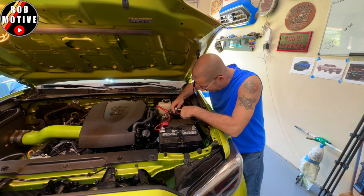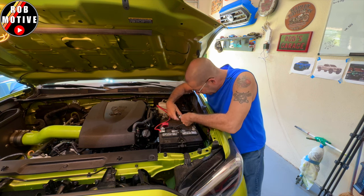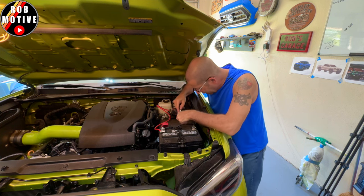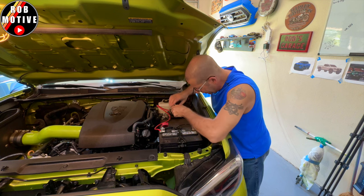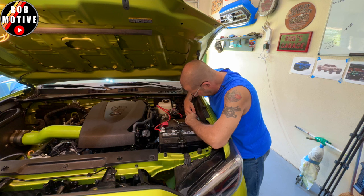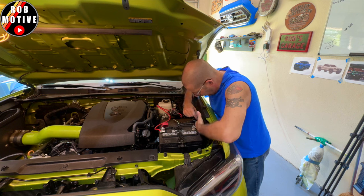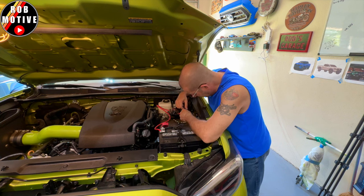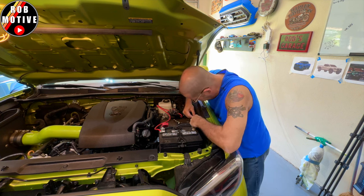Why? That's a good question. But before I get into that, we're going to go ahead and take the negative ground off of the Auxbeam switch here so I can depower this thing — obviously I'm not looking to shock myself while doing this. So we're just going to pull this ground off. It's a little greasy; I think it's because I'm using the same bolt. Let's get this wire out of the way — I really don't want to contact anything with it or I'll go to ground again. All right, I've got that off. Let's go ahead and put this screw back in before I lose it somewhere.